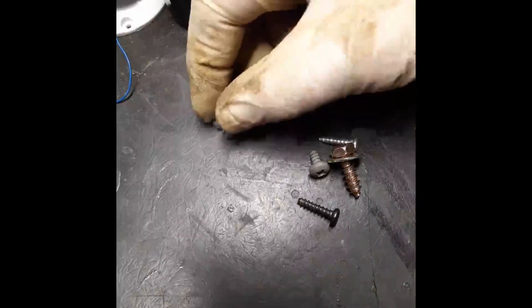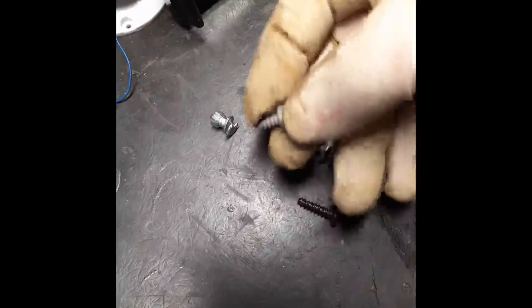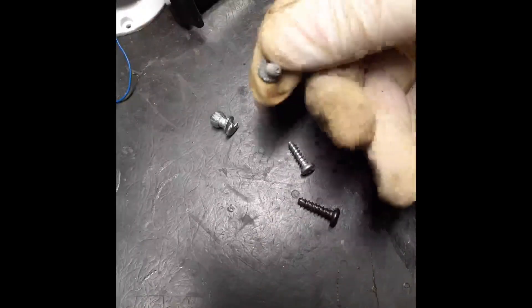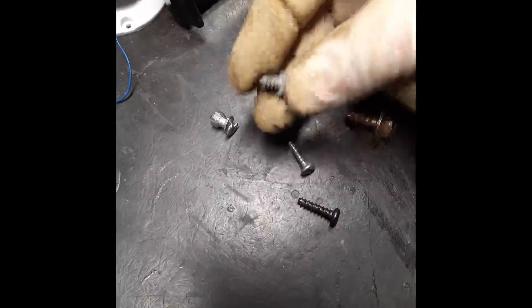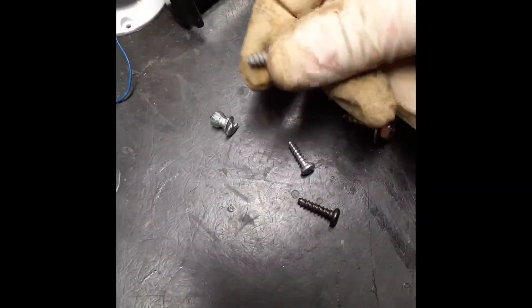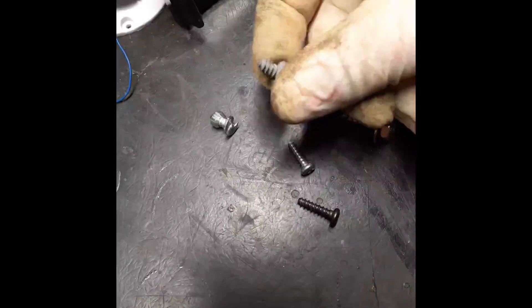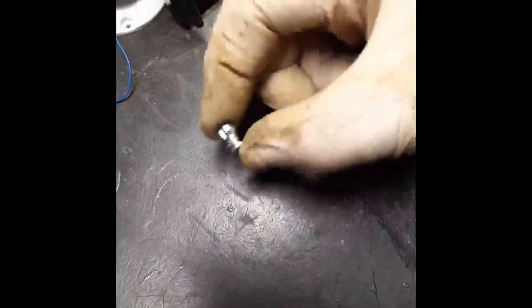I certainly don't want them flying loose on the highway. Anything flying loose on the highway will at a minimum shatter someone's windshield, cost them a ton of money. If it gets through the windshield, they're in a lot of trouble, because then it's going to hurt someone. Also, it will disable someone else's vehicle by puncturing their tire. So don't use anything except an actual screw-in stud.